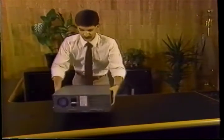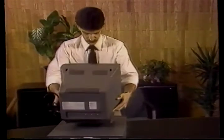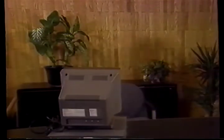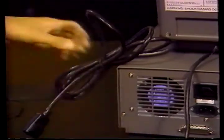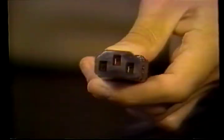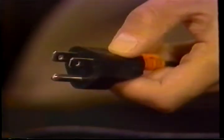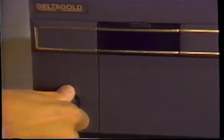Place your Delta Gold computer on a surface that offers solid support, availability to AC-grounded outlets, proper lighting, and in an area that provides total accessibility to your computer and its installation. Set the keyboard in front of the CPU and remove its plastic sleeve. Undo the Elite monitor's attached video and power cables. Both the Premier and Prestige system monitors come with attachable three-slot female and traditional three-prong AC plug, much like this CPU power cord.